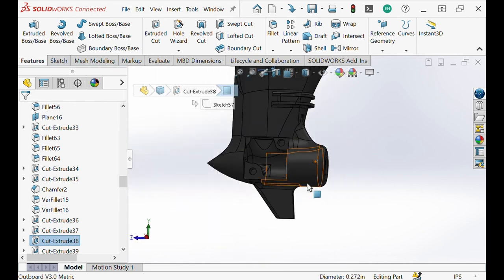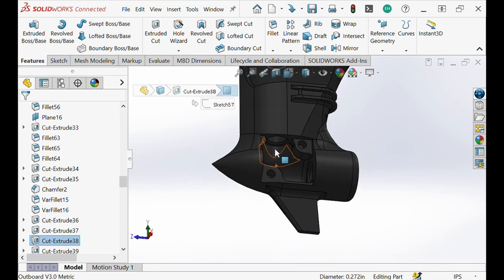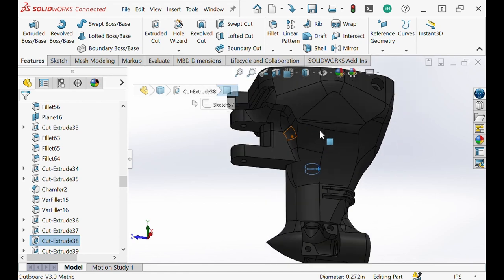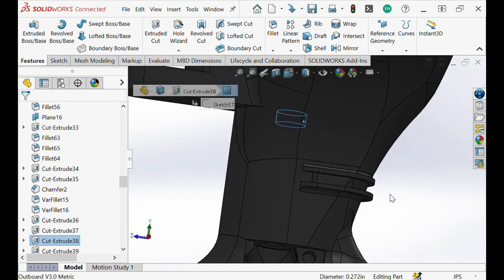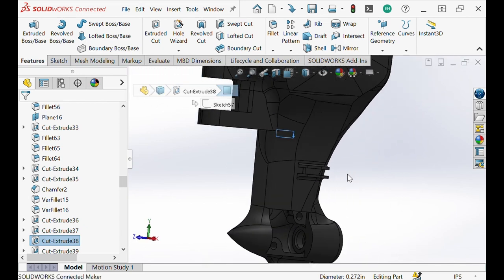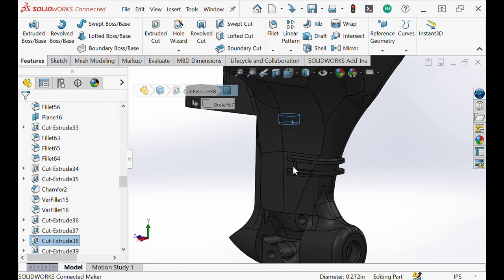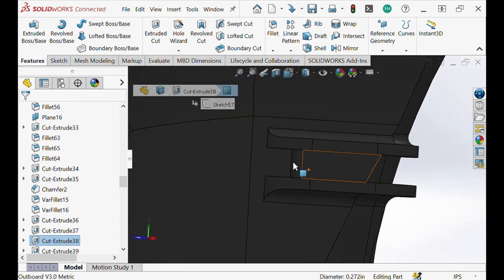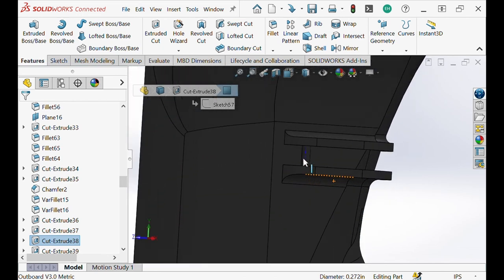Working from the bottom up, these are the little holes for the heat inserts. Depending on how good your printer is, you may have to drill those out slightly with a small drill bit to get the heat inserts to go in nicely. Going up to the top, this is the slot — the attachment feature for what I call the whale tail. That's the anti-ventilation plate that stops you from sucking air when you go full throttle from standing still. Super important, or else your propeller will suck air and you'll have horrible hole shot. There's a little detent here for where you push the whale tail on, and that holds it in place.